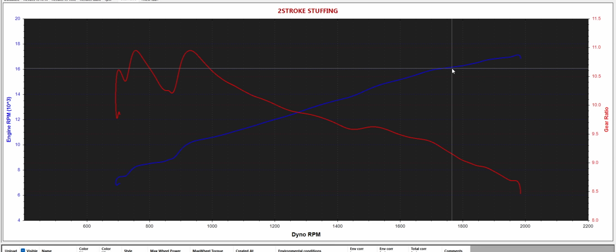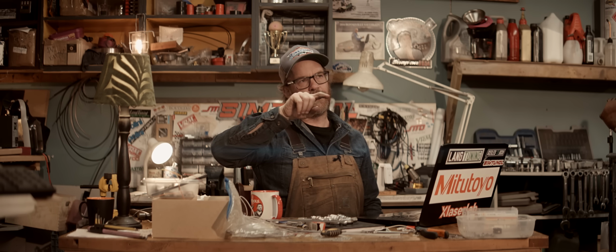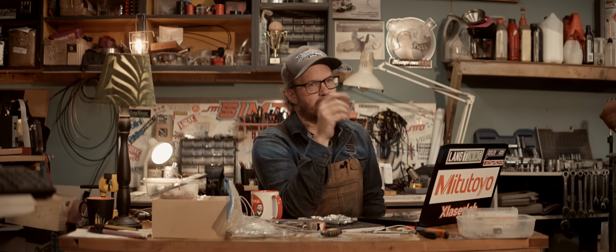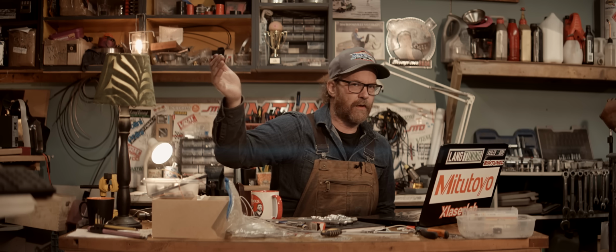We're varying a little bit, especially up top here, where the engine is slowly rising from 16 to 17,000 RPM. But if I use a locked gear ratio like I did, the dyno thinks it's climbing to over 19,000 RPM, which isn't correct. Also explains why it's easy to take off even though it's below the power band, and I can still pull through and up to 2,000 roller RPM.